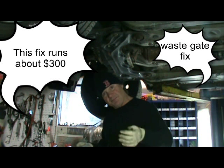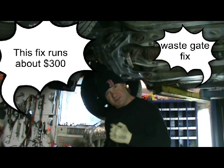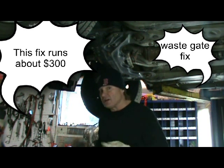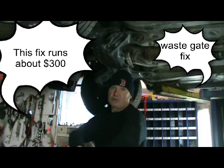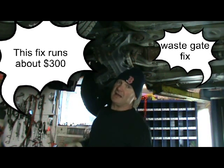The first step is that most of the problems are the wastegate diaphragm that closes and opens it — it's a vacuum-actuating diaphragm. They are serviceable. Dealers tell you they're not serviceable and that you're going to buy a whole turbo for a thousand bucks. That's a lie — they are serviceable.